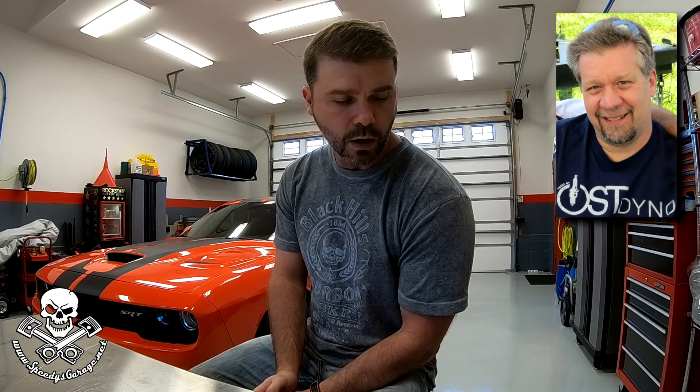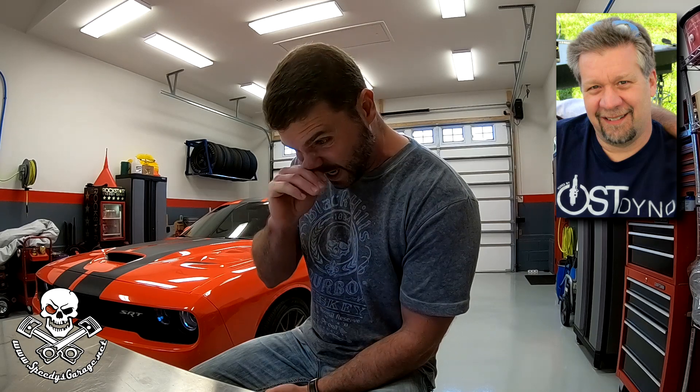Somewhere information started circulating that that 2.72 would provide too much boost to run on 93 octane pump gas. And I know where you tuned Orange Crush, the previous RT that I had, we had that thing running on 93 and I think it made close to 16 pounds. And I never heard of any issues with too much boost on 93. Now obviously I know you get to a point where I wouldn't want to make 20 pounds on 93 because then by the time you pull out all the timing to account for all the extra boost and heat, you've lost all the benefits of that 20 pounds of boost. But tell me what your thoughts are on where you think the limits might be for a car boost wise on 93 octane.